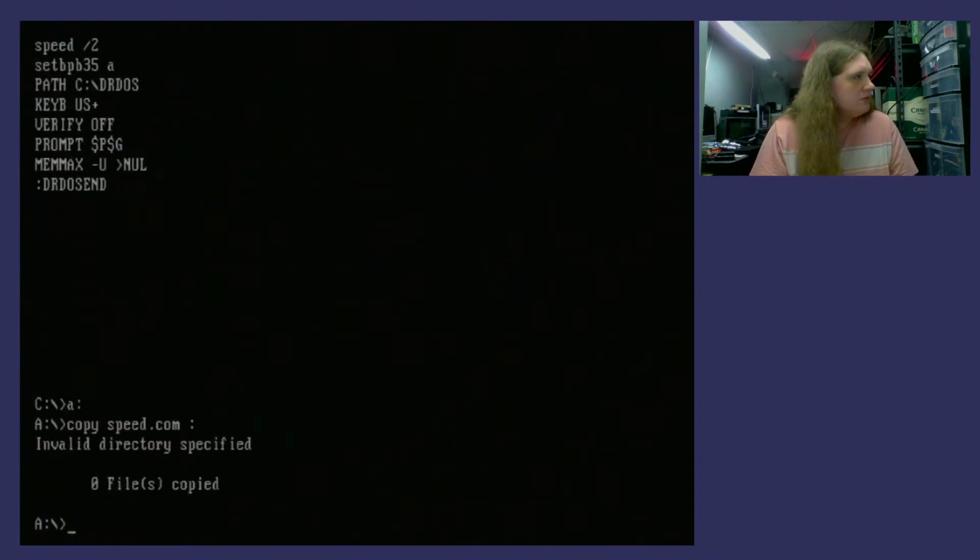Oops. That's another thing this computer's been doing. It's just started doing that like this week, where it'll start missing keyboard strokes and beeping instead, as if some invalid scan code was sent. And I hope it's the keyboard having an issue and not the computer having an issue. I'll have to bring the original keyboard here and see if it does the same thing.